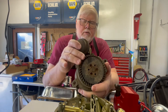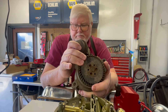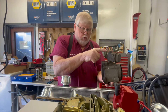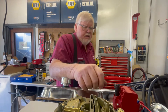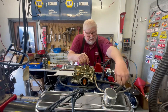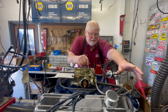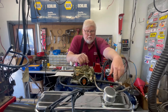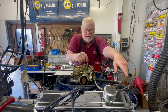This vacuum line, when the vacuum gets high from decelerating, it turns this thing off. Now it blew air through this hose here that connects, and then on the Caddy there was a tin manifold that connected both cylinder heads, and it had a check valve sitting on top. That's another thing you can't get replaced — those tin manifolds would rust out or get destroyed from guys prying on them and not knowing how they actually connected to the head.